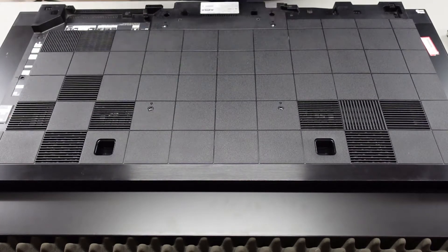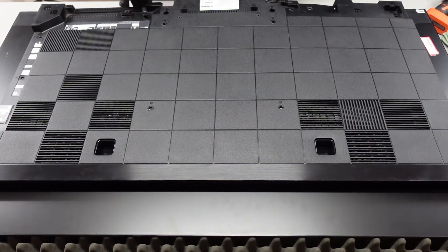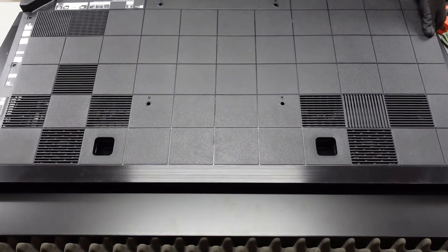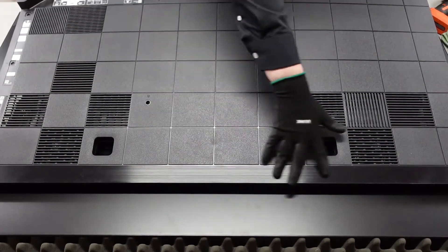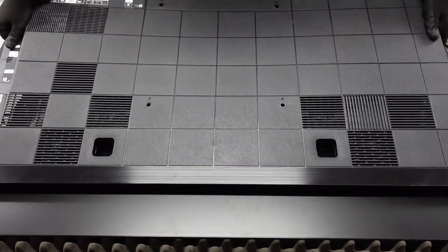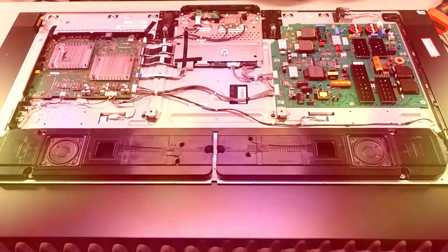First let's get these screws removed. Over here on this corner there's a little lever — you're going to want to shift it towards you. You'll see a little arrow pointing directly towards the bottom. You're just going to push it — you hear that click — and then from this point we can start lifting up on the back. Slowly shimmy around the side, you'll feel it pop and give way from the chassis. Once you have it lifted up about this high, this top piece is latched into the chassis, so shift it away from you towards the top and that whole piece slides directly off.